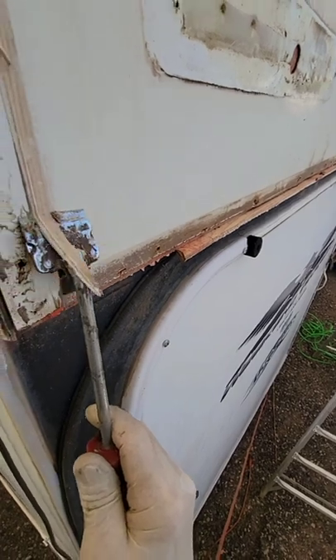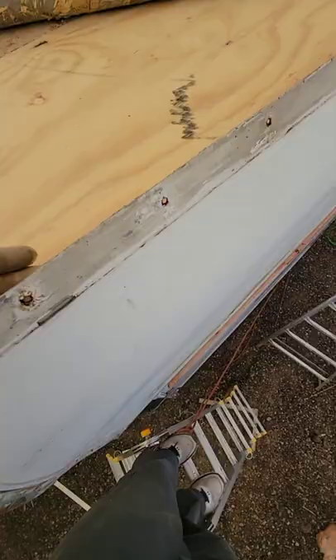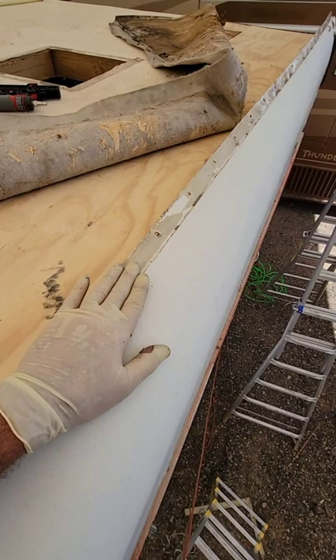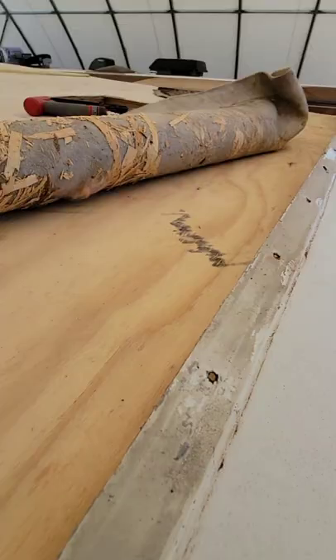So I do have the back wall on now, so you get it prepped and ready to go down. I was able to laminate it. Unlike the factory, I wanted to have this edge underneath the rubber. Before, the factory had it like this on top, so when the water came down, it just went straight underneath the wall. So now if I can put this down first, and then the rubber on top.